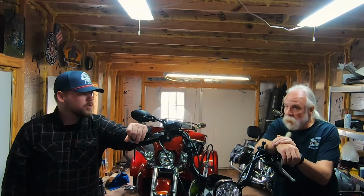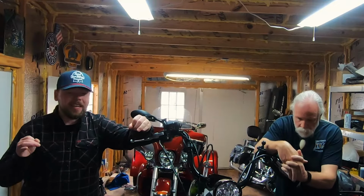I can't tell you the number of times I've had questions on the forum, emails, and I know you get them on the phone. People saying, well, I'm waiting to get my air cleaner, or I'm waiting to do my exhaust mod until I get a tuner. And the fact is that M8s don't come from the factory too lean. Unlike their predecessor, the twin cam, where you absolutely needed to optimize the fuel management. Not the case on the Milwaukee-Eight.